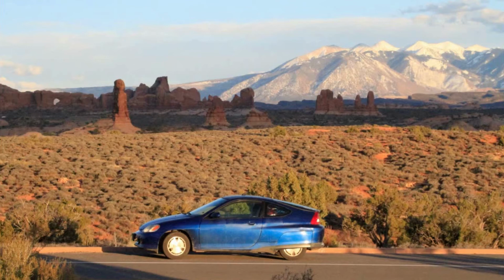There's my awesome car with the LaSalles in the background. But yeah, one caveat I'll add right now is that after about 10,000 miles or so, the IMA light did come back on. So what I figured I'd do is I'd try the grid charger. And I used some light bulbs and I was able to discharge the pack and recharge the pack with the grid charger without having to take apart the whole pack. And that seems to turn the IMA light off also. So I'm not sure if I really needed to do the cells individually, but I definitely think it helped.